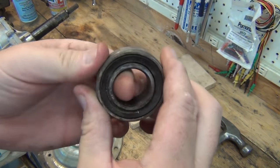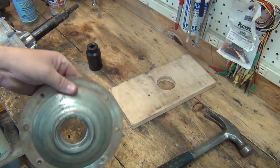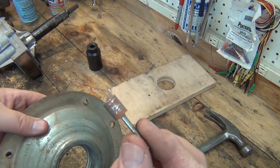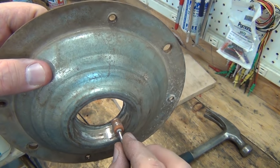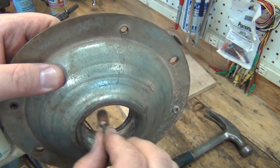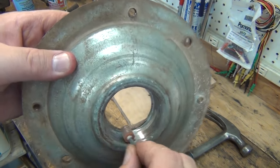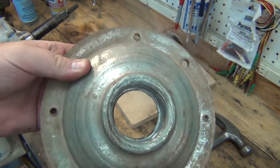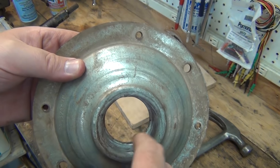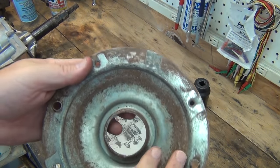You can see that's pretty messed up. At this point there'll be lots of crud and stuff in there. I take another Dremel tool with a little grinding wheel and get in there and grind off all that gunk. Don't try and make the hole bigger — just grind off the gunk and grind off any of those crimpings you might not have gotten completely off. You don't want to increase the size of this hole, you just want to clean it up good so the next bearing goes in good.